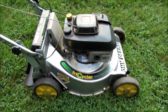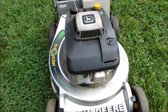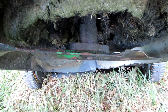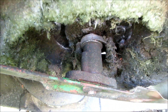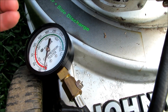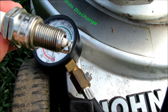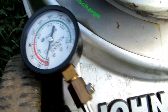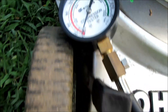First we're going to see if we can get this to fire. We'll top the oil off and check to see if it's getting any gas, and do some basic troubleshooting on the John Deere. The blade looks okay under here, definitely got some age on it — let's sharpen that up for him too after we get it running. It's got one of these weird E3 spark plugs in it with the dual end. I'm going to run a compression test first and see what the compression looks like. I feel compression in it, but let's test that. He said he put a new spark plug in it, so let me roll this over a few times and see what we get.